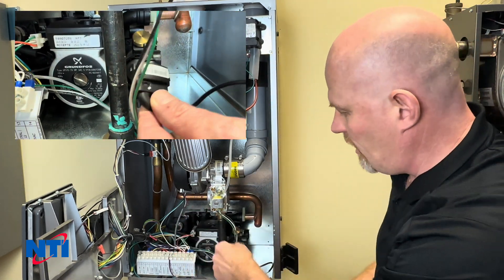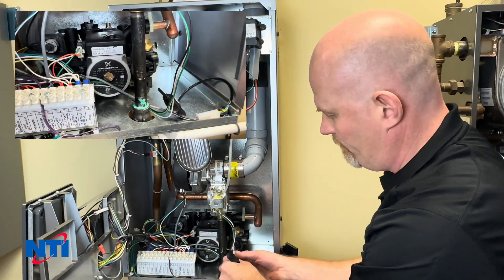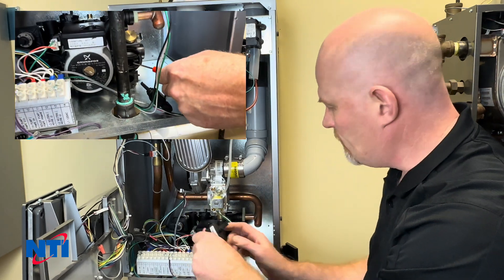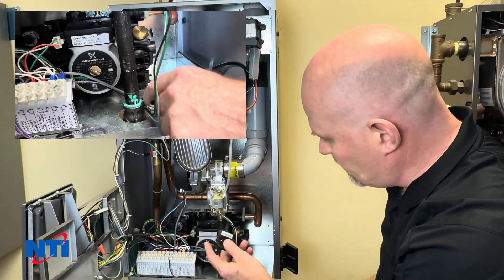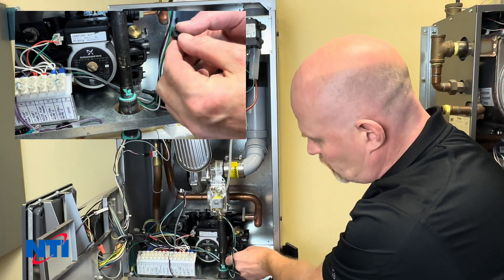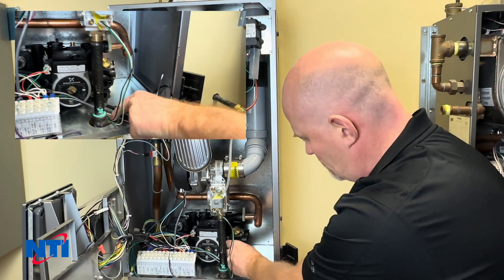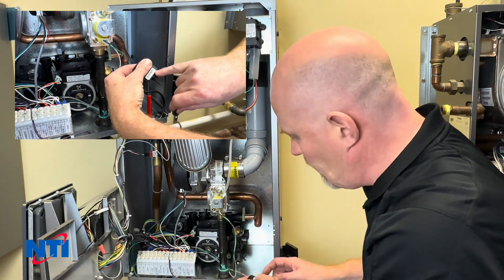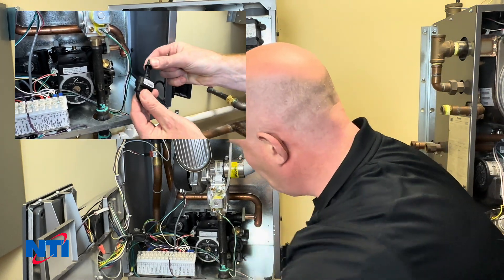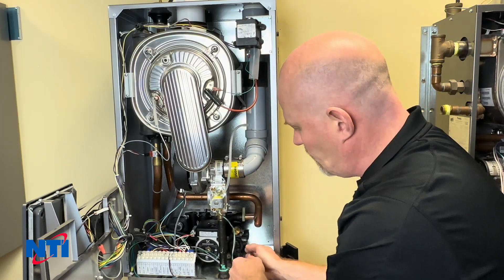You want to pull out this little clip, pull the sensor out, and disconnect the wires. What's happened here is the old rubber o-ring and gasket has stayed inside there, so we're just going to use the sensor to pull it out. You want to make sure these do come out, because in some cases they stay in there and you will not get the new sensor in with the old gasket.